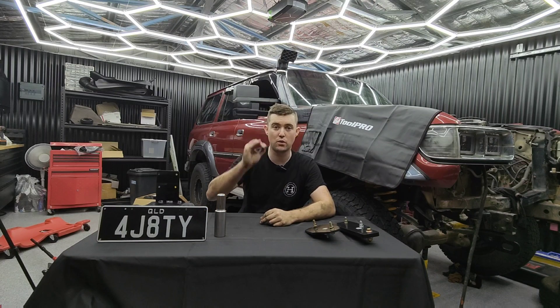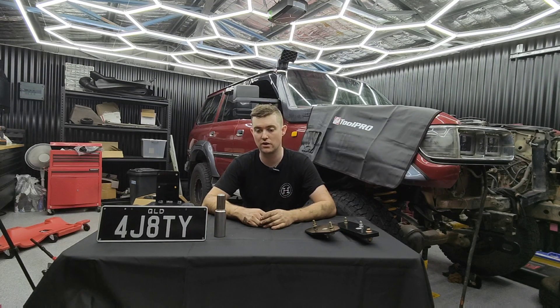This box does not have an overdrive gear, which is absolutely perfect for what I want to do. I'm going to do a lot of towing with this car and I don't need an overdrive gear - fourth is going to be absolutely perfect. And then I can change the diff gear ratios later on the track if I absolutely need to change any final speed RPMs on the highway. So it's all going to be plug and play and see how we go.